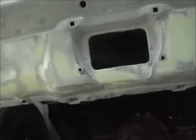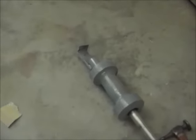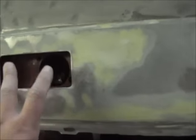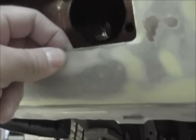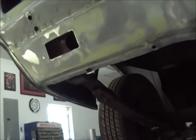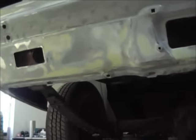Same deal over here — I took the slide hammer and basically pulled all this out the best I could, which I should have done during the metal work but wasn't thinking about it at the time. I had to pull some of that back out, same over here — got it pulled back out to where it's really really close. But these panels flex — you can see just barely moving them, they flex in and out. It's really tough to sand and do body work around that because they want to flex in when you're sanding.